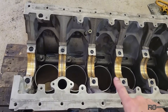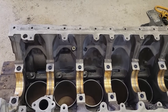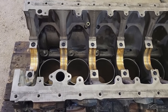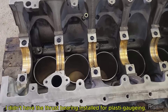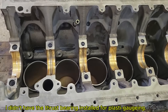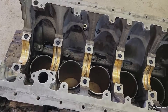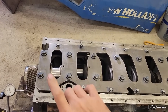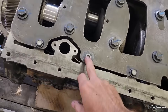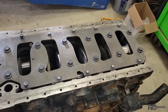I got my bearings all lubed up and ready to drop the crank back in. The plastic gauges came out a little bit tight, actually — showing about a quarter thou on the tight side. Quarter thou is not very much. I noticed when I took it out that I didn't have the crank totally lined up. It was actually the chamfer of the journals up against the bearings, and so that could be why it measured a bit tight. So I'm fairly confident that we're going to be okay, and I'm going to put it together the way it is. Crank is in and torqued up.